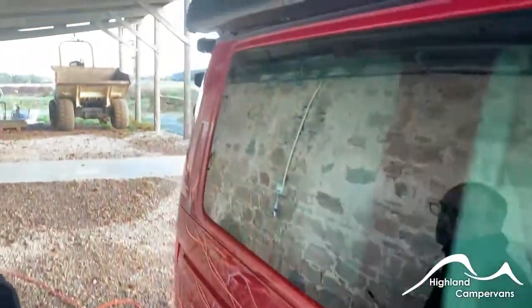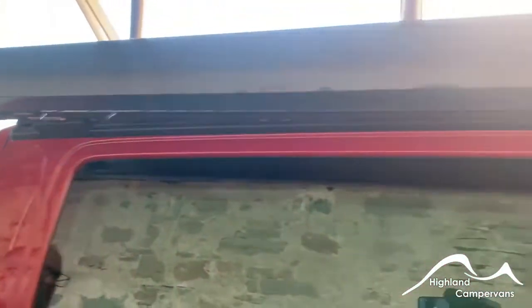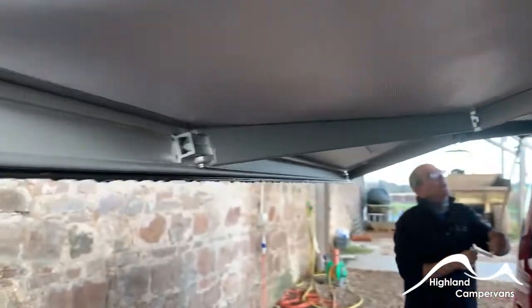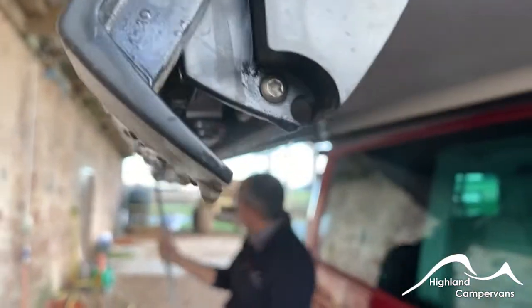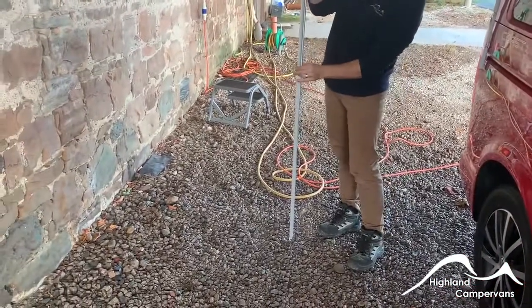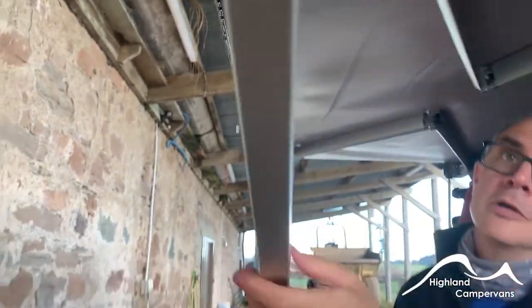For the awning to work, make sure the sliding door is shut fully. Put the T up into the slot and then twist the awning accordingly and begin to wind it out. When you reach a midpoint away from the side of the van, open the jaw of the pelmet and you will find the individual legs spring-loaded up inside. Push in on each individual tab, let the leg go down through your hand, and then lock it off using the lever. Repeat the same process on the other side.